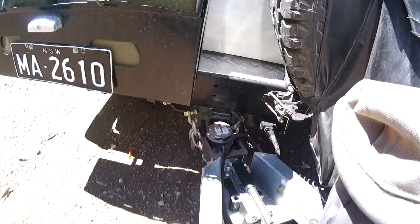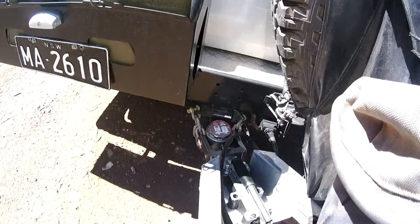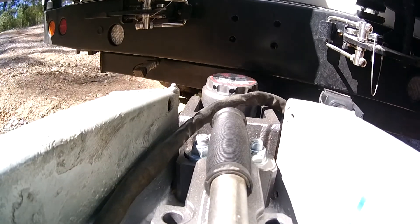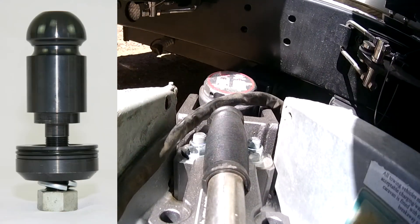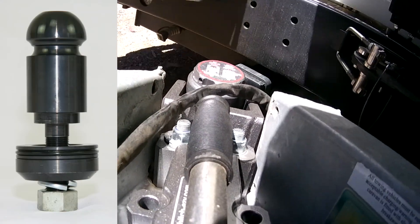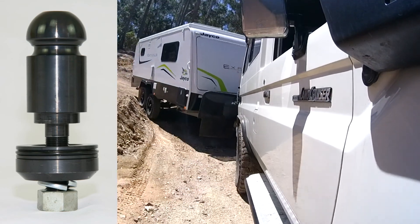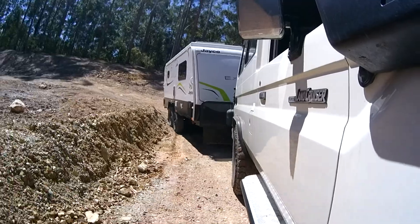One of the main advantages with this unique towing pillar is the ability to easily unhitch, regardless of the angle or the loads on the pillar, given its parallel sides which take all the forces. That small dome section is only for the self-centering, and the recessed groove is where the locking mechanism automatically slots into.